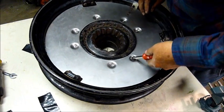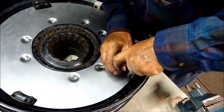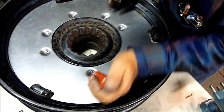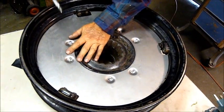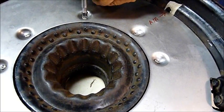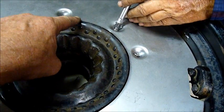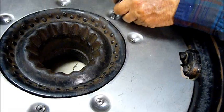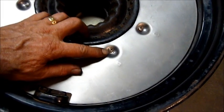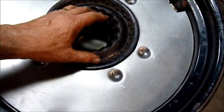We actually have a quarter-inch spoke wrench to help us from the other side. There's so many spokes in there it's hard to get it down in there, but the nature of the quarter-inch spoke wrench is such that it has a long mouth on it, so it can reach in at a pretty steep angle and still give it a cinch if need be. Our little piloted tool here is doing a pretty good job. We can pretty much tell how tight to go on these because the edge of the backing plate is drawn down evenly around the perimeter of this inner hub. Once it's all drawn evenly and pretty snug, we have the completed backing plate installed in the wheel cover. All of the fasteners are below the level, so there's no brake drum interference when this bolts up. The backing plate is below the surface level of the back of the hub.